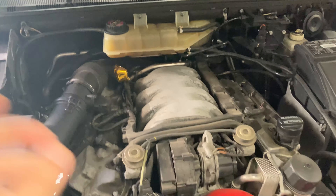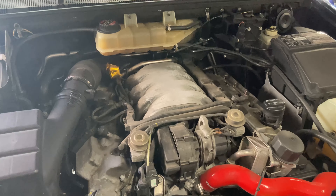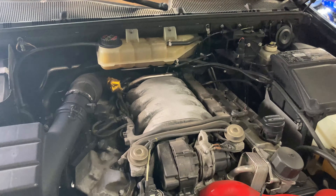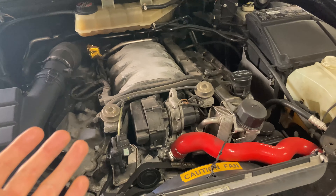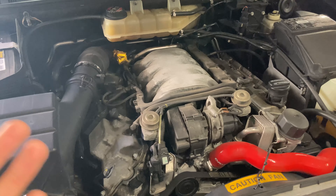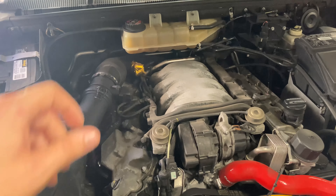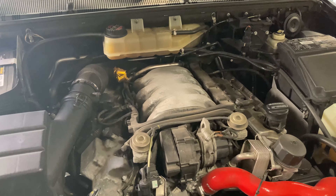The coolant light keeps coming on and off. I've tried to bleed it and topped it off, but after driving, when I stop, you can hear the expansion tank bubbling. If you know anything about motors, that can be a sign of a head gasket going bad — but for the M113, that's really rare. The motor is still performing fine, not acting weird, so it's a very low possibility. Fingers crossed, but nothing points directly to a head gasket.